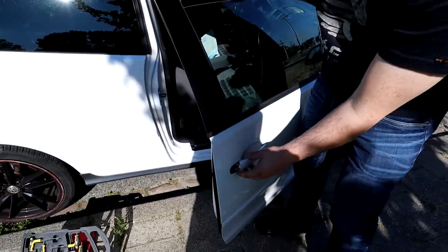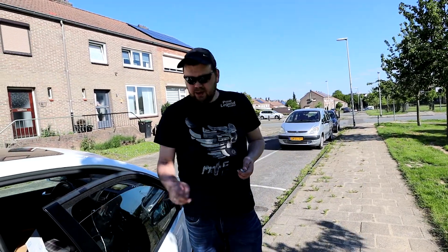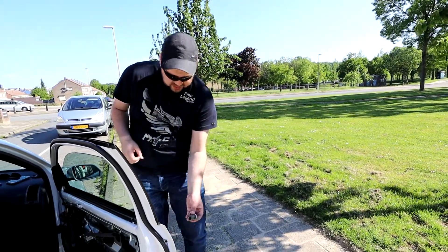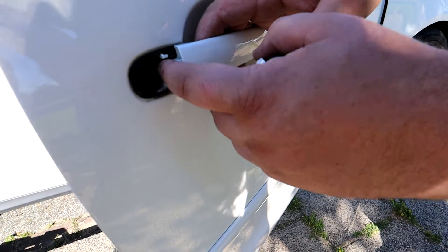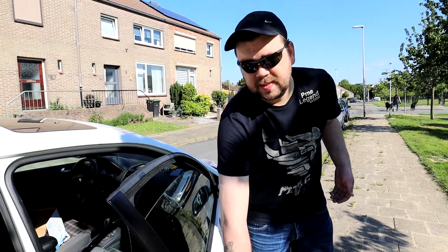Now we have a problem, because the door handle from the outside would not work. We saw a video where someone made this open to release the tension. The problem is, nowhere was it described how to replace that. After a lot of researching, we found out that there is a bolt in here — all the way in here, it's a torx. You unscrew it, but don't take it entirely out, then this one comes out. You can see the little plastic part that goes into there. Before we found that video on how to do that, we tried from the inside for like an hour or two to put this in.